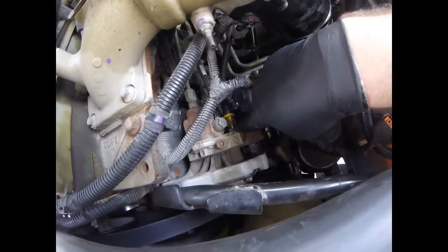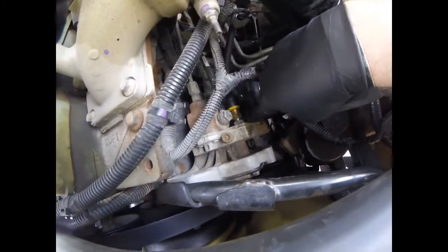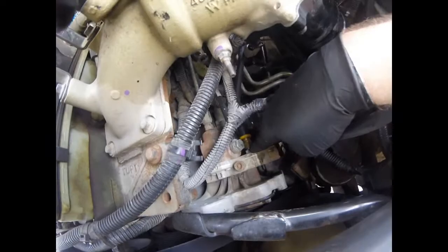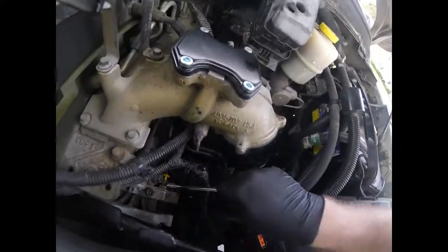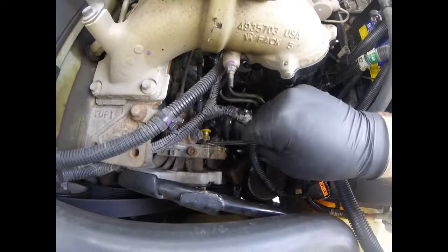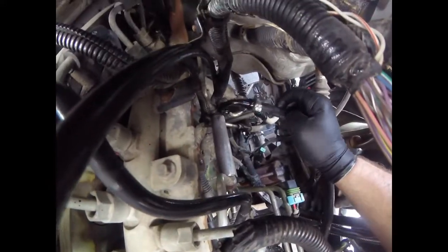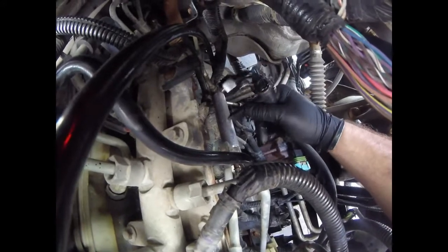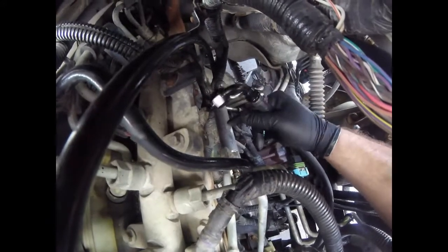Here is the delete tube — it's on there. All four banjo fittings and washers are in there. The only one we have left is down here: the fuel supply line for the CP3. If you see what I mean, you have to remove that banjo bolt to tighten this, which is why I had both of them tightened together already — so all I needed to do was screw it in with a 17. If you have a thin enough 17 it fits right on there. You want to make sure it is pretty tight. As for the banjo bolts going into the aluminum housing — the bolts are steel and they will strip out the threads in that aluminum, so make sure it's tight but don't go nuts with it.